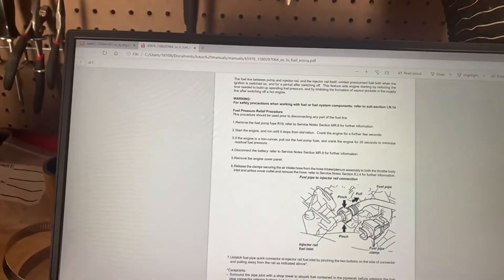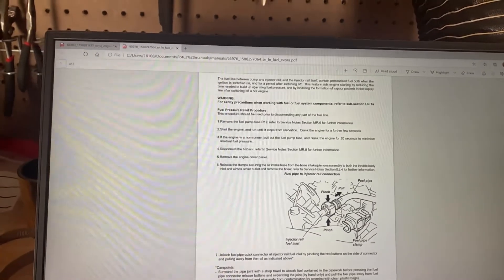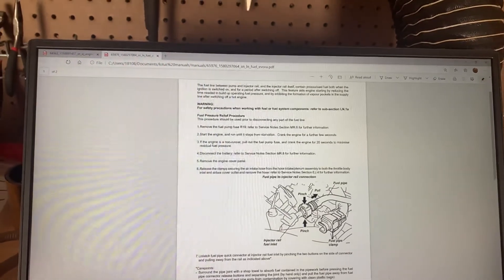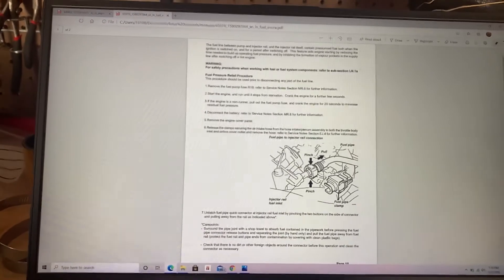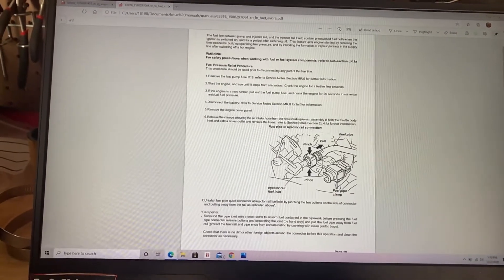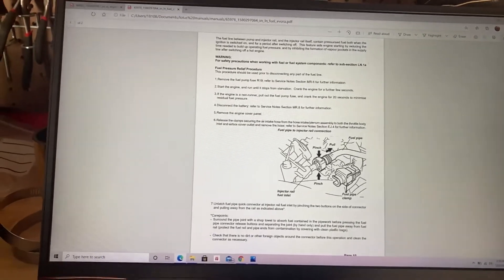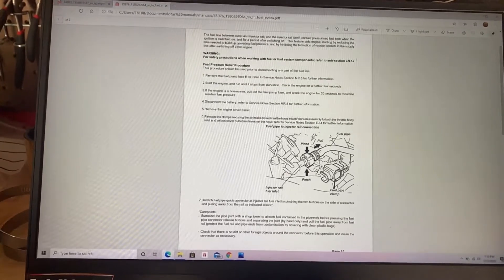Our next step: they say to disconnect the battery in reverse order, but we're not going to do that because we're going to be putting a fuse in first, get that settled, and then put the battery in. The reason they want you to take it off first is so you can turn the engine over to expel the gas in the lines and depressurize the lines — but we're going to do it in the opposite fashion. Once I put the battery back in and turn the key, we want that fuel pump to come up to pressure. At that point we're going to jump out of the car and make sure there are no fuel leaks anywhere before starting the vehicle. We want to make sure there's pressure in the fuel rail and at the fuel regulator, with no leaks.